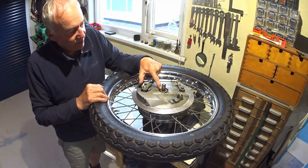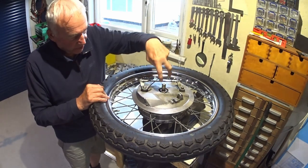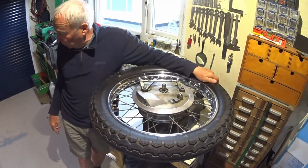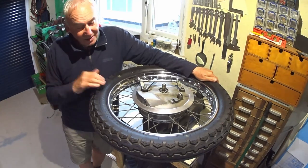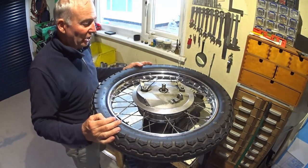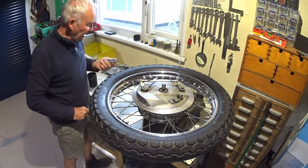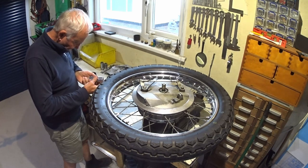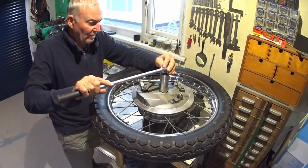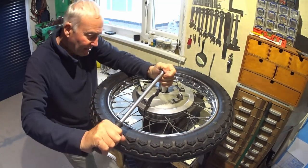So even though it's similar to the BSA — the BSA one, instead of having a castellated nut, has a disc with two holes drilled in it — I know the wheels are exactly the same because I've just put the B25 front wheel in the Daytona to move it and it fits perfectly. Same wheel but maybe a few changes. This off first — it's a deep series socket, inch and an eighth across the flats, conventional thread, so lefty loosey.